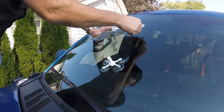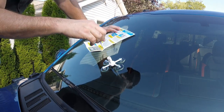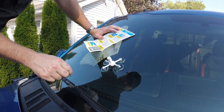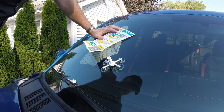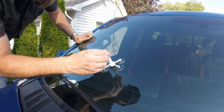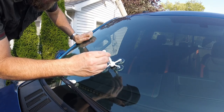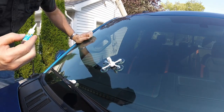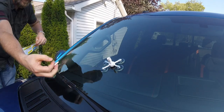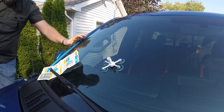Now I'm going to squirt the resin in there. Then you screw the pressure driver down into it. Put a couple drops in and then twist the thing down. I'm going to squeeze the resin in — three to six drops. One, two, three — that should be enough for this small one. Then I'm going to push this in — the pressure driver, whatever you want to call it. Being a truck, you have to kind of really work at it.